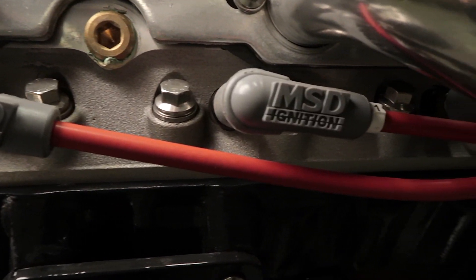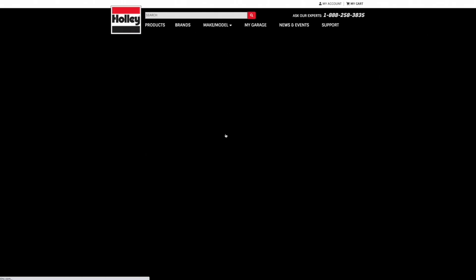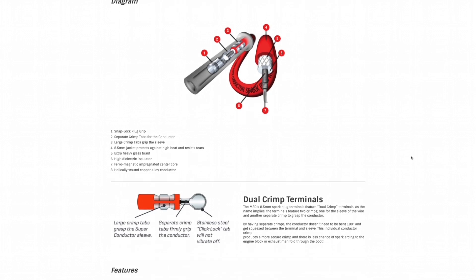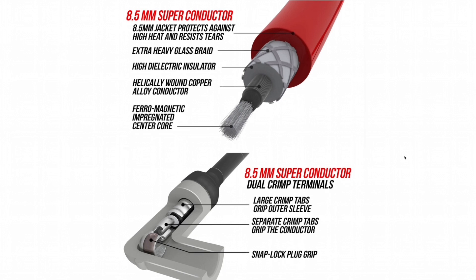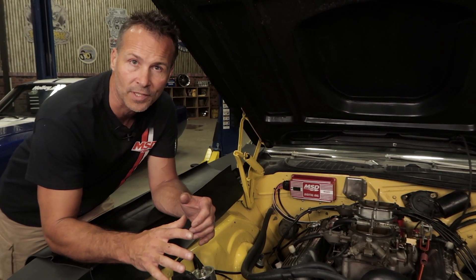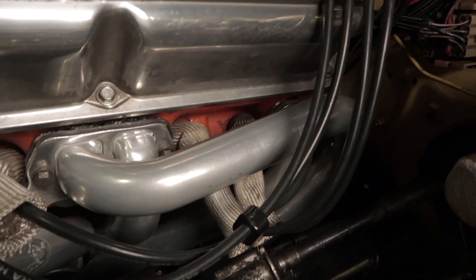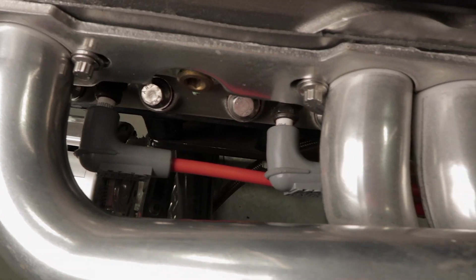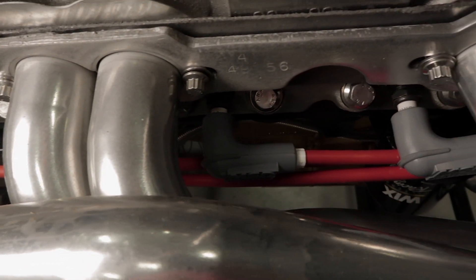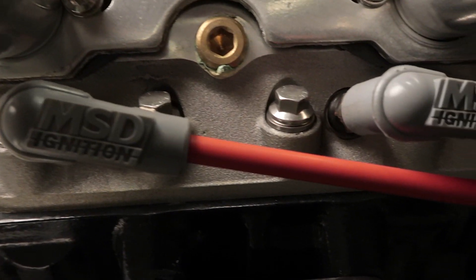Misfires in older vehicles are a common issue, especially if you're still running original spark plug wires and non-resistor spark plugs. Plug wires are a key component of your ignition system. We recommend a good quality helically wound spark plug wire — never use solid core wires. Helically wound wires provide a clean path for the spark while keeping electromagnetic interference from affecting the 6AL's operation. Spark plug wire routing is also important — route wires well away from high heat sources, moving parts, or sharp objects. Also avoid routing wires side by side that fire next to each other in the firing order. For example, on a small block Chevy, number 5 and number 7 wires should never be run together. If you have to cross wires, do so at a right angle — this reduces the chance of voltage being induced between the two wires, which can cause detonation or more serious engine damage.